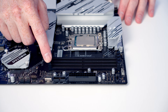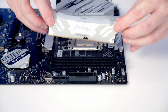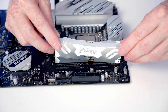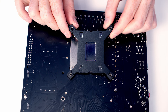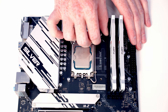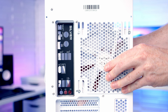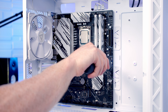We're now ready to install our RAM. Open the clips on the second and fourth slots along from the CPU, line the RAM up with the slots, and apply firm pressure to clip it into place. Same thing with the second stick. Next, install the bracket for our CPU cooler — because we have an LGA1700 motherboard, set all the clips to their outer setting, then line the back plate up with the motherboard and push it into place. Add the spacers into each corner with the thicker end screwing into the back plate. Just before installing the motherboard, push the I/O shield into place, taking care not to cut yourself.